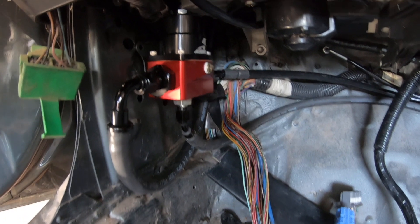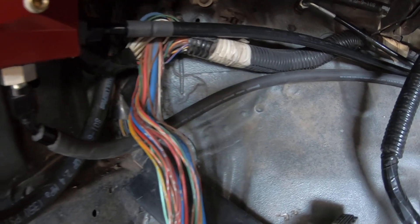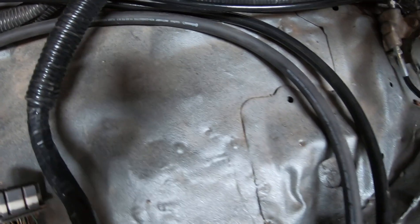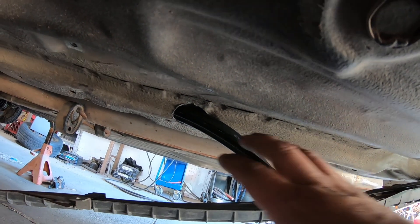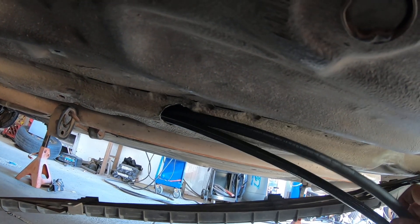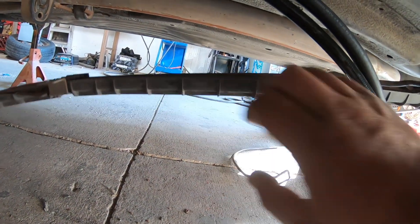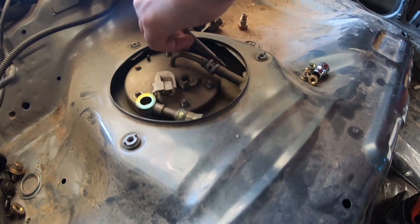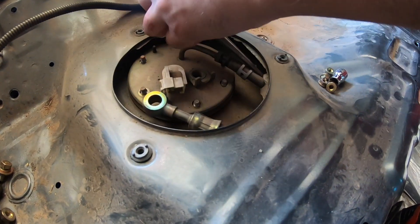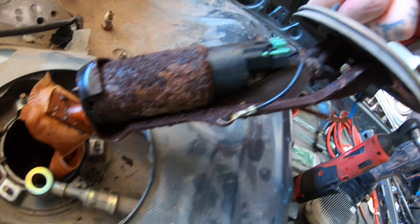So this is where we're going to mount the fuel pressure regulator, and there's the fuel return going out the bottom. The fuel feed and the fuel return go into this channel in the car right there, and it goes all the way down this way, then it comes outside the car underneath right here. Here's where the lines come out — we just made a hole right there, and these lines will fall into the old channel where the brake lines and old fuel return line were. I'll just cut this about right here, remount it, and the lines will run inside that and go to the fuel tank.